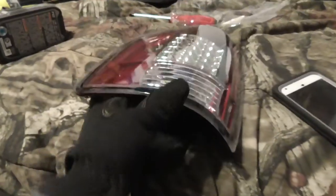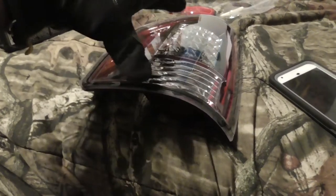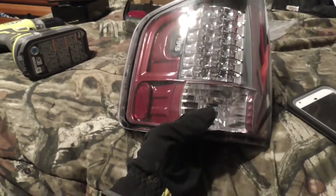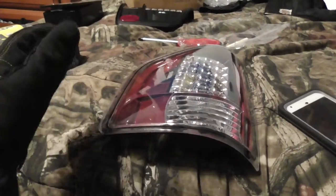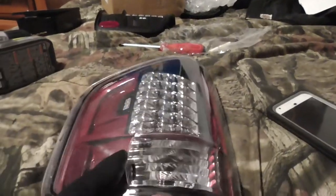Basically what I did, after I put this on, I just taped the lens, lay it over where it needs to go, push it down as much as I can. Then I heat it up at 260 for 5 minutes. That's plenty for this stuff. And then just go around, pinch it down all the way around until it stops. And there it goes. It's all down.